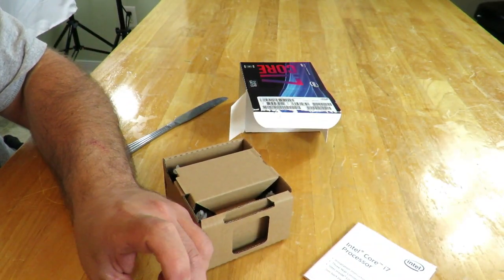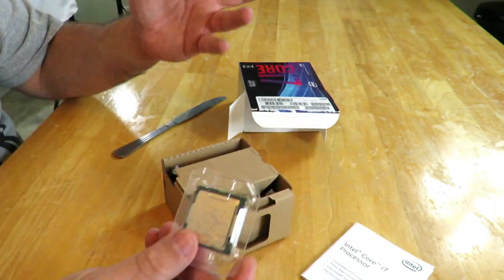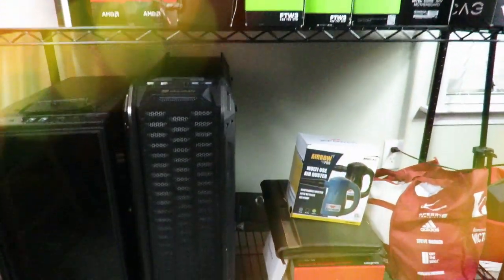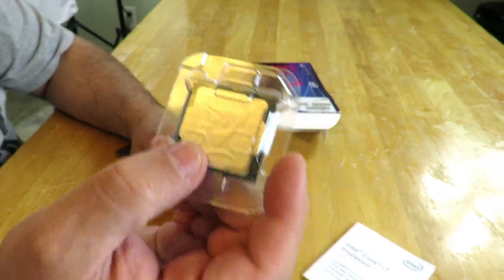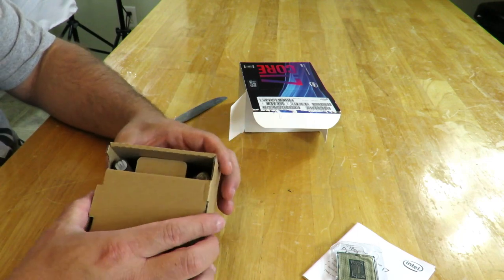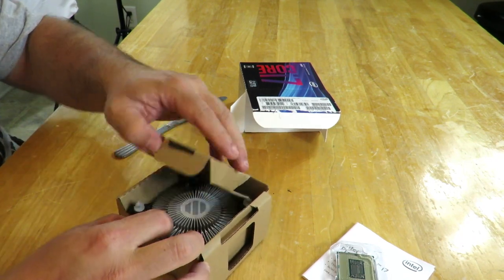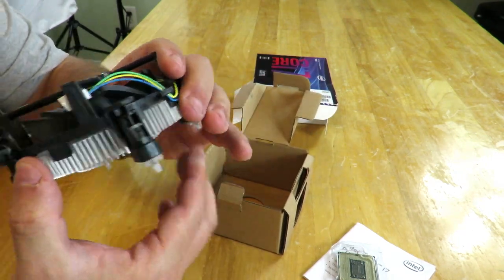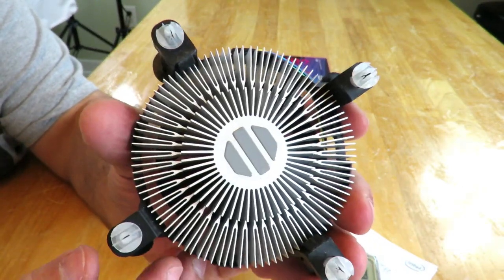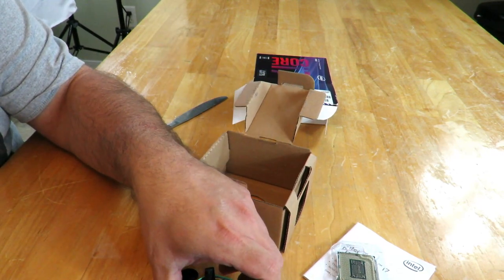Let me go ahead and put this back. What I always do when I build a machine — I keep all the boxes — I keep this in case I want to update the processor or do whatever; I can put it back in here, that way nothing comes in contact with the back. Not that many people use this, but this is a good starter in case you're dying to build your machine and you don't have a third-party CPU heatsink. Intel includes a very low profile CPU heatsink with some pre-applied thermal paste. These guys clip in to the holes on the motherboard itself and click, and it's in there.